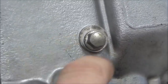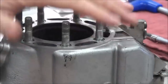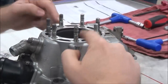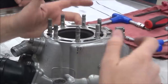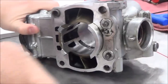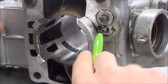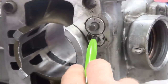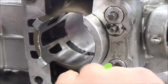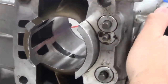It's a coolant drain - that's exactly what it is. So if you were just going to take the cylinder head off to check the piston or whatnot, what that allows you is to drain the cylinder down that far so you don't get coolant all over the motor and bench. A nice little feature. Now looking at the bottom here on Kawasaki, you can see these three different pins - these will be part of the pinions and this is where all the timing happens for our rack and pinion system. This is pretty gummed up, not sure if it's going to be easy to take apart.